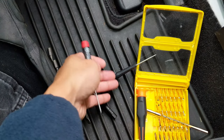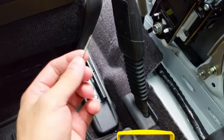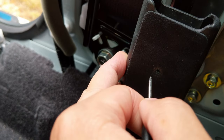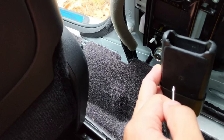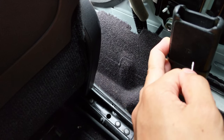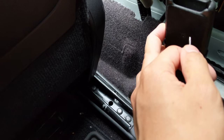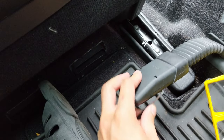What I found most useful is actually not using paper clips — instead, get three smaller screwdrivers. The first thing you want to do is push the seatbelt inwards to give it a little bit of slack. Take one screwdriver and, while giving slack, put it in that single hole right here and press it a little. You'll feel that when you give it slack, you're actually able to push in the depression clip. Tilt the belt down and apply pressure downwards.